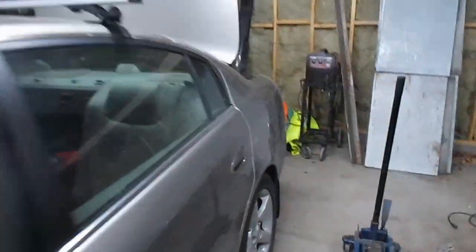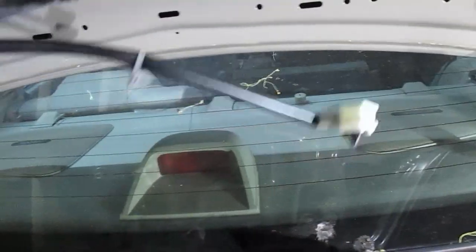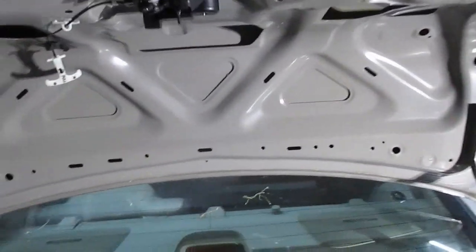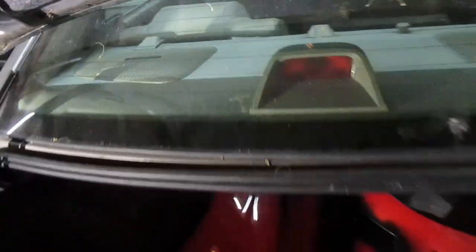I ended up pulling the trunk liner and had to pull the wiring harness out — those are the license plate bulbs. One of these sockets is for the rear mount tail light off the SER. I'm going to install the trunk and on a later day hook up that third brake light. The trunk has officially been swapped and the carpet replaced. There was actually a plug on my wiring harness for the third brake light so I didn't have to splice anything in.